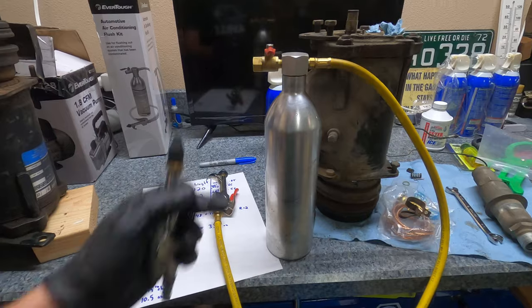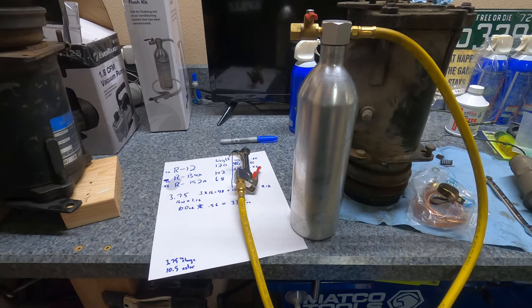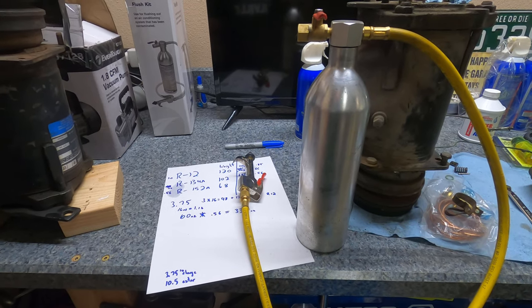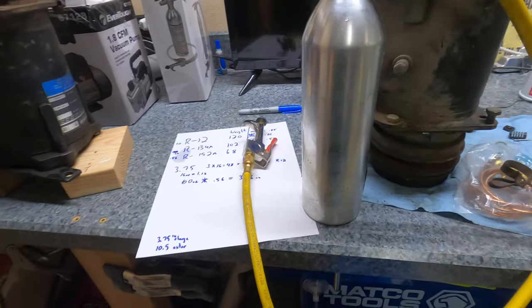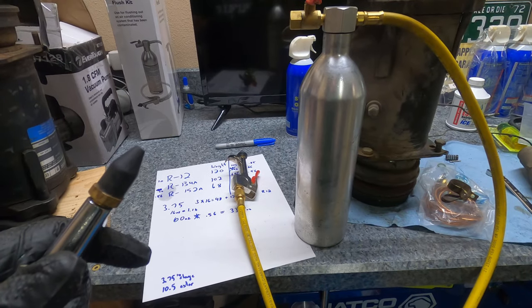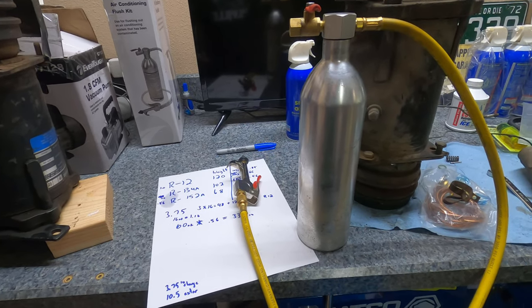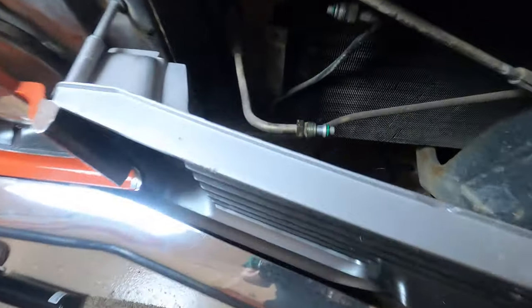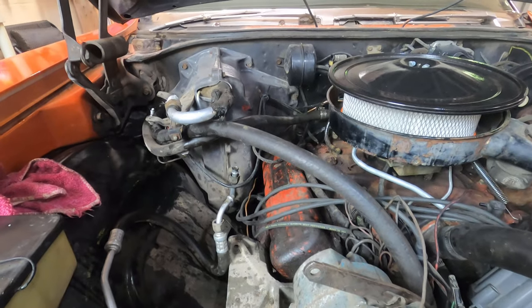The flush system is all set up with solvent already loaded. The directions are: blow compressed air through all your lines, condenser, and evaporator — not through major components like the compressor or POA valve. Run the solvent through both ends of all those components, then go back through again with compressed air to dry everything out. That's all there is to it. Here you can see one end goes onto the dryer — it blows out some mist.